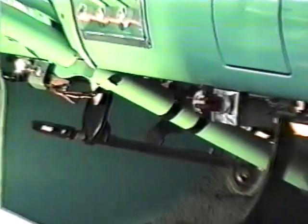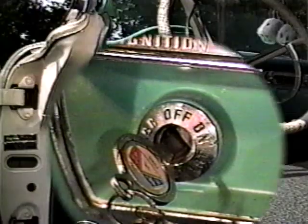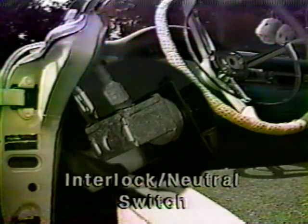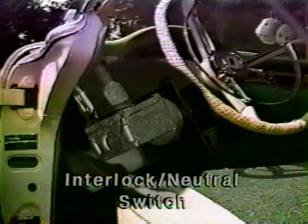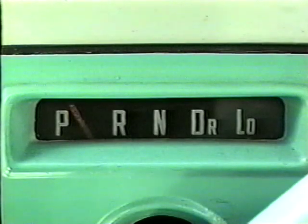The starter relay is located under the hood and is the connecting point for the wires that provide battery voltage to the rest of the system. Two circuit breakers are mounted inside the passenger compartment just above the kick panel on the driver's side. The 10-amp breaker protects the control voltage, while the 45-amp breaker protects the common motor feed. The ignition switch enables the control voltage when it's in the on or accessory position. An interlock switch mounted under the dashboard on the steering column prevents the top from being operated with the transmission in gear. This switch is set from the factory to operate when the gear shift is in neutral.